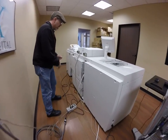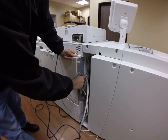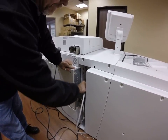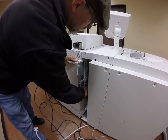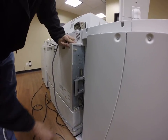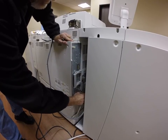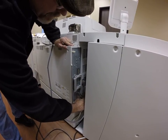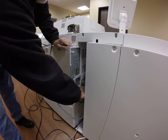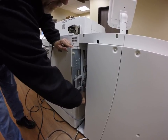We'll walk over here. This is the back side of the printer. We will take the thumb screws and remove the data cable which connected the Fiery. We're also going to take off this crossover cable — this enables the scanning. We have a cable right here for the UI; we're going to take this off the card cage with the thumb screws as well. And we have a cable here that leads up to the scanner — we're going to remove its thumb screws as well.